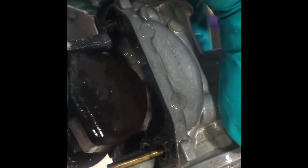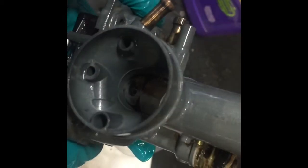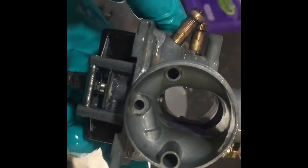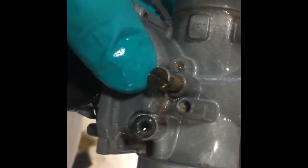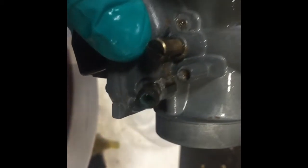The only thing I'm worried about is what it's like on the rubber — it's kind of corrosive, as I say. I hope it's not hurting the main jet. I'm gonna pull the needle out and pull the floats out to get that all cleaned up in there. Hopefully it doesn't damage the rubber and break the seal. You can see there — it looks almost like corrosion — there was a bunch of green stuff in there. This is a four-stroke, it doesn't have any two-stroke oil in the gas, or at least it shouldn't.